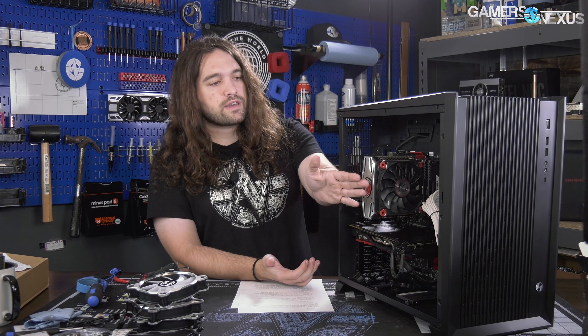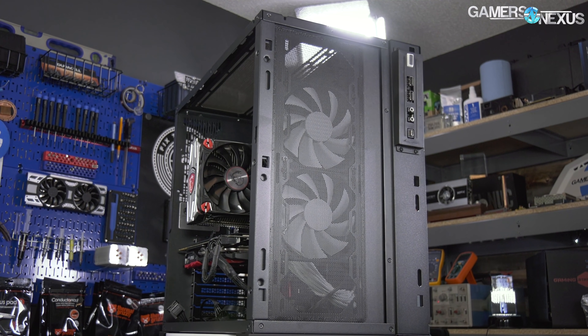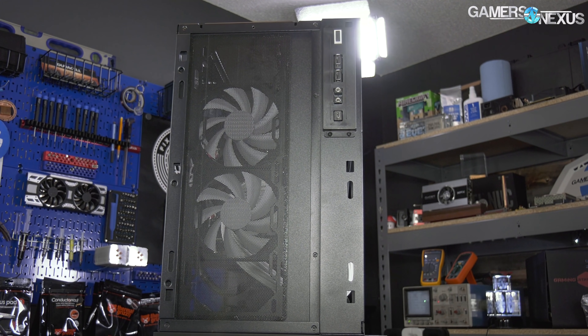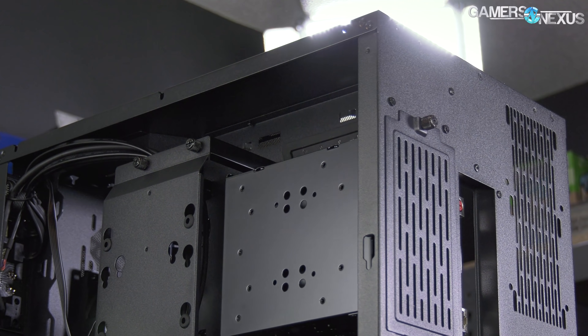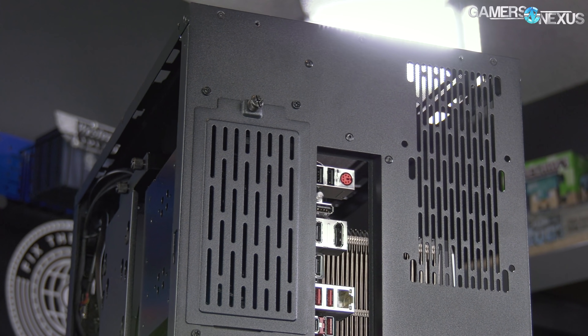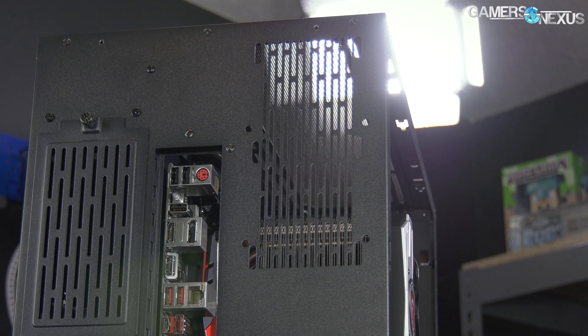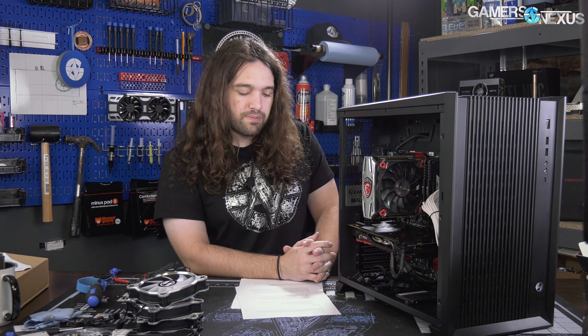For the stock setup it comes with two 120mm fans in the front. This should be a pretty decent performer, but as you'll see later, there's some interesting play going on with the dust filter. Other core changes include the front now supporting three 120s or two 140s, and you can put two 80mm or 92mm fans in the back due to new threaded holes Lian Li added. The two included 120s max at 1500 RPM for the base version; the RGB version comes with Bora Lite fans also maxing around 1500 RPM, give or take 10%.